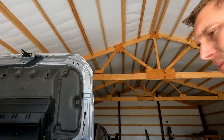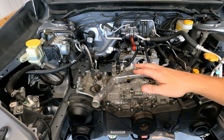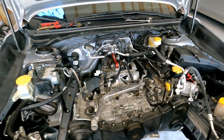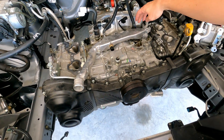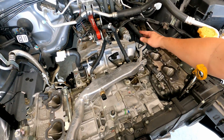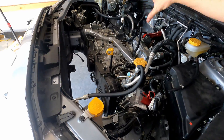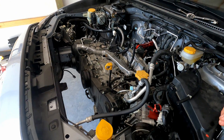What's going on y'all? So on the Subaru today I'm going to be — I might actually get to pulling this thing out today. First thing I'm going to do is go ahead and get the coolant crossover out of the way. To do that I need there's two 10 millimeter bolts, one here and one back there. Got the Corbin clamps for the heater core hoses. I've got to pull those off and then get those two bolts out and that should all come right out. After that I'll move on to the starter, so bear with me just a minute.